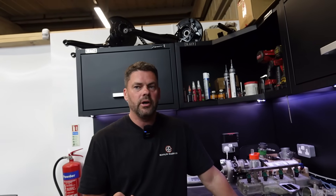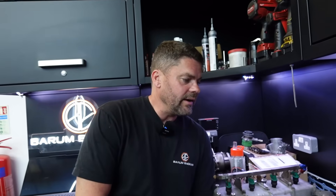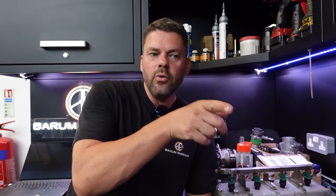Head wise — very good head. The ports are 24 and a half on the exhaust, 25 and a half on the inlet. It's a solid lifter setup, and we all know how pricey and time consuming that is — good amount of money just for the kit, let alone setting the thing up properly. It's got a pair of Newman cams in it. I've measured them — 38mm base circle, 9.6mm lift on the exhaust and 10.6mm on the inlet. I rang Ken Newman but there are no identification marks on the end of the cams like usual, and he's got no recollection of the sizes on these lifts. He said that's very odd and he expects it's probably a custom grind for someone — a custom job away from any normal spec, specifically for somebody.